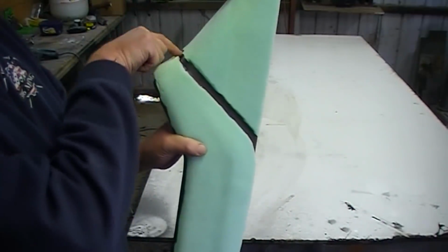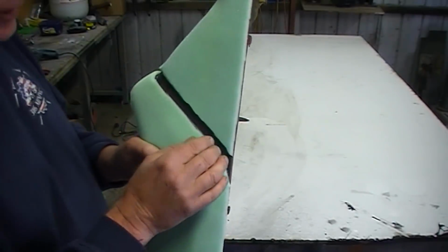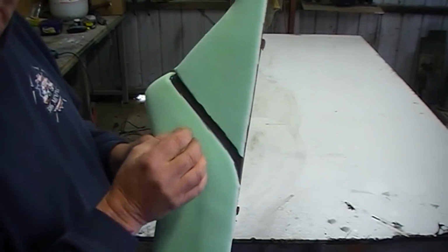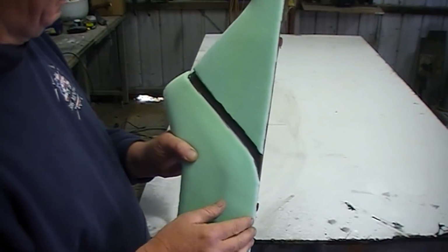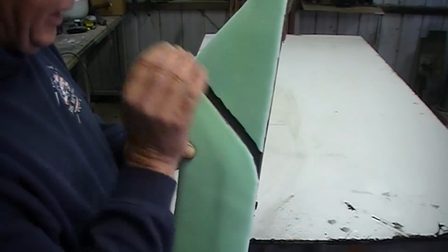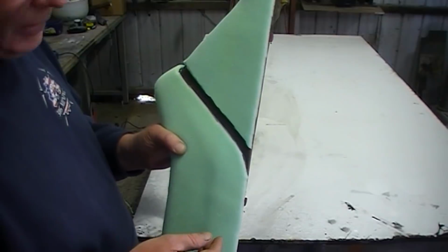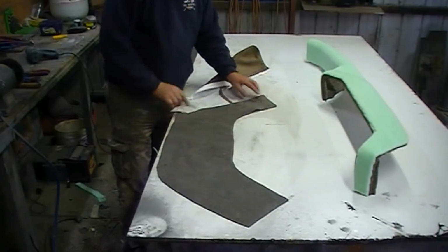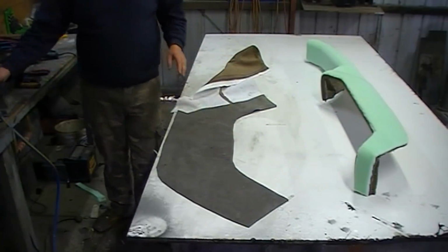And I've left that section there just in the original vinyl because I need to glue that seam down, and it needs to be in exactly that position, and it needs to basically bind to something solid, because that whole seam is the definition, or delineation, of the two fabrics. That has to be good. If you glue that seam onto foam, it'll probably sit in the right spot, but it's better to actually get it onto the hard deck. First things first, I'm going to glue this seam and glue that. I'm going to get this cover in position first, and then we're going to cover the dashboard.